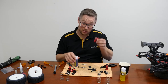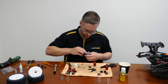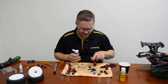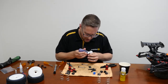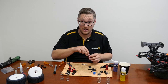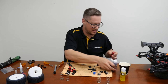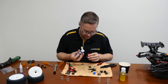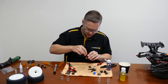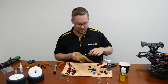What I'm going to do is put the rear shock shafts back in the shock body. Before I do that, I'm just going to drip a little bit of oil down into the shock. A little bit of oil helps to stop the O-rings from getting damaged or nicked when putting the shaft back through. So a bit of oil through there — it slides in much nicer. Do the same with the other shock shaft, dribble some down until it goes into the hole, then slide the shaft through. Good to go, and there'll be no damaged O-rings so we don't have any leakage.